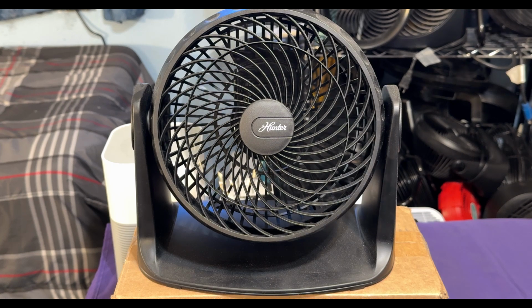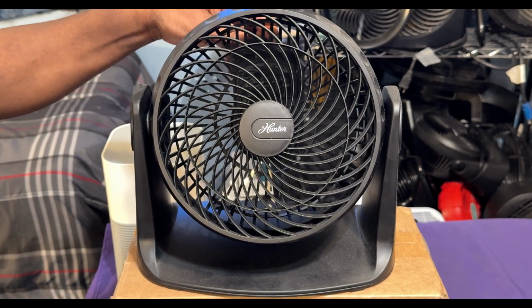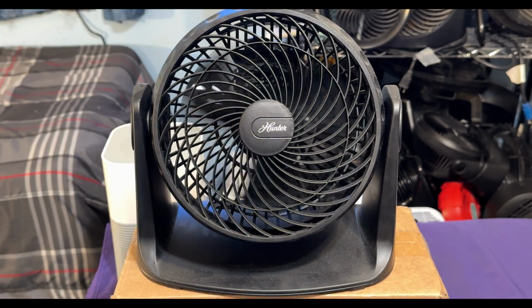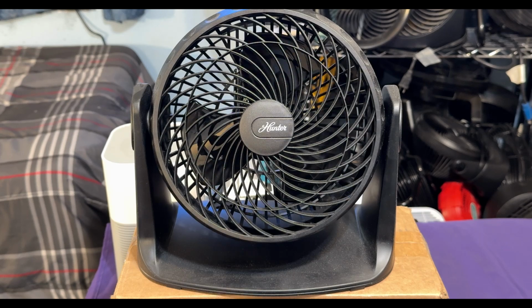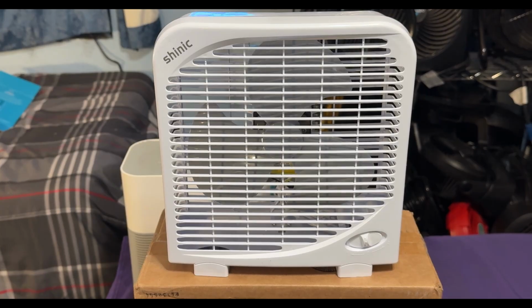But here we go. Spin down time. Yeah, that's about what you can expect when they don't put enough oil. It's just a typical basic shaded pole motor. Just give it some oil in the front bearing and it'll be okay. Lamont the Fan Man, now good night and going to sleep.